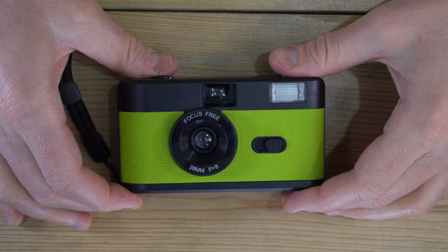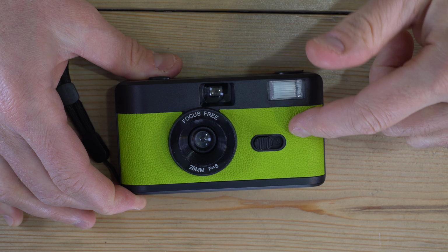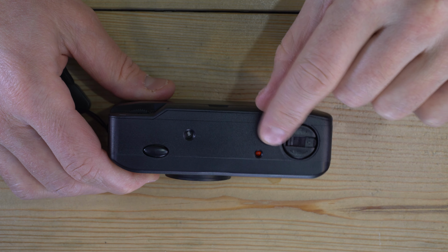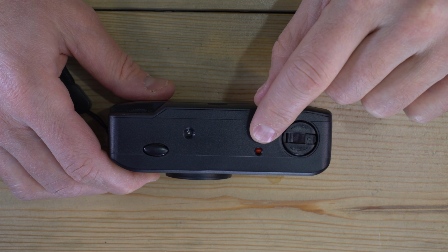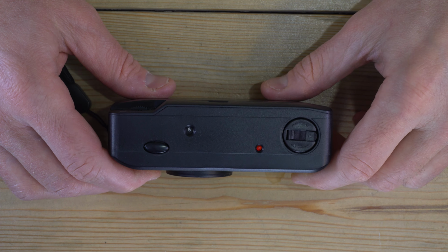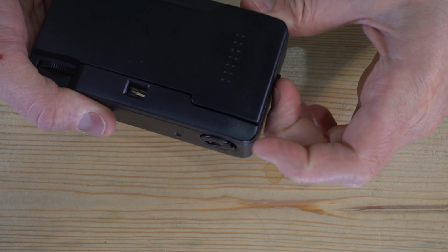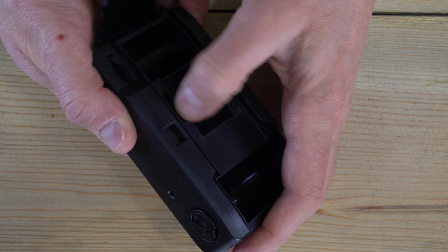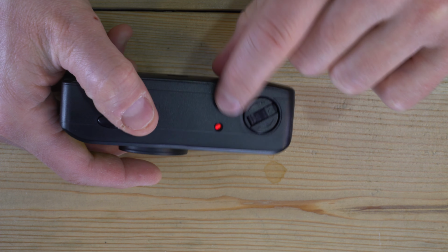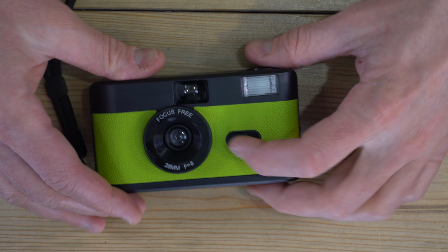To use the flash, it's pretty simple. If we have the battery in there, all we have to do is turn it on. You'll likely hear a very faint capacitor whine, and as you do, this light will light up. Now, the first time you ever use the flash, this is going to take a little time to light up for the capacitor to get charged for the first time. Then, oops, would help if I actually armed the shutter, I suppose. There we go. Then when you have the power on, and the light is lit up and you go to trigger, the flash will fire.